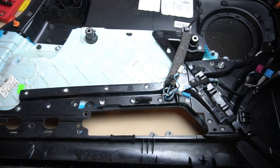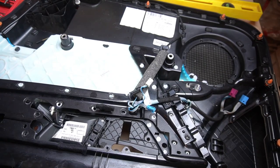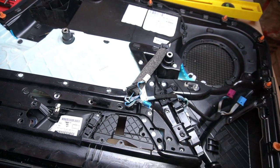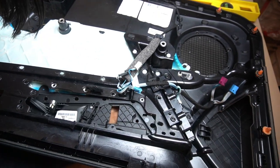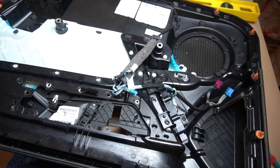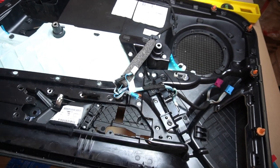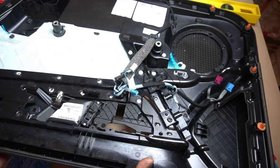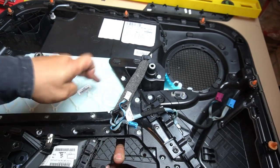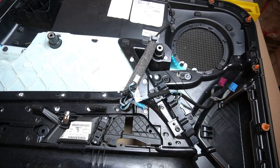To reinstall this, make sure you tuck it back in and everything lines up as it should. Separate the top piece but also push down on the bottom piece to give you room to install this back inside — you need to get this inside and get these holes over these tabs. Make sure these tabs come up through the top and ensure all the other tabs line up. Lift it up and we're back in. Now use the supplied screws and screw everything back in — that will hold it back together again.